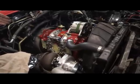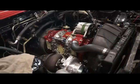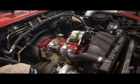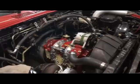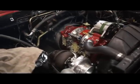'93 third generation flywheel, pressure plate, second gen clutch mechanism. Actually, the pressure plate is off of second gen because it is a push type rather than a pull type like the third gen. But basically, it's a turbo 2 block with third generation internals.